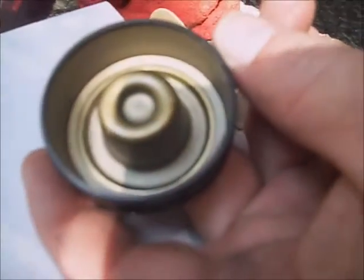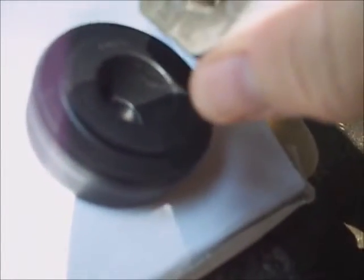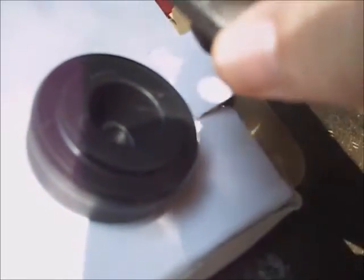This is a new replacement piece — I got it online since the dealership can't get it anymore. It's a bonded metal piece, rubber coated, and inserts into the transmission. I'm going to be taking a bushing and threading it inside of this to pull the old cover out of the transmission. It's like a three-quarter to half-inch bushing.